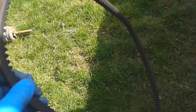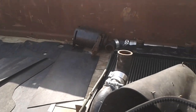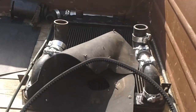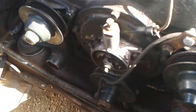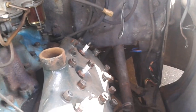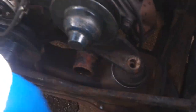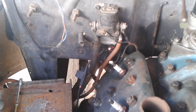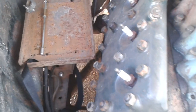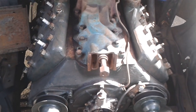There's the fan belt - took the generator out, the dynamo, there's all the mats from inside, there's the transmission cover, there's the radiator. I've taken all the mats around the transmission, took off the distributor cap and leads, just undone the fuel pipe, took the generator off which meant undoing the wires that go over to the regulator. The engine mount bolts are out, so the awkward thing now is I need to deal with the exhaust which is kind of down there - I might have to do that from underneath. And the starter connection - I'll keep working and give you a little update when I'm a bit further down the line.